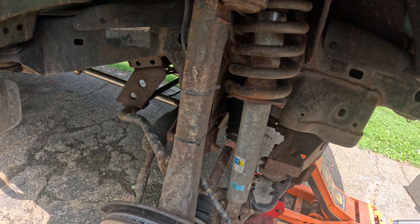I want to show everybody what I meant when I said drill them out. I probably would have just cut these ones but I wanted to show you what I was doing. This will probably need a little more drilling, but I'll take a flat head and tap it against the side to get the nut broke free — either spin it off, or if I drill the sides wide enough I should just be able to tap the whole thing off the stud. Obviously this is going to destroy your studs, but if you have a brand new strut assembly you won't have to worry about that.